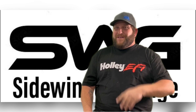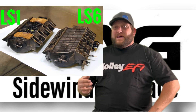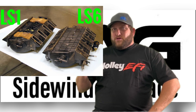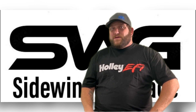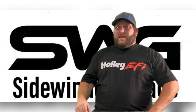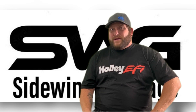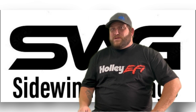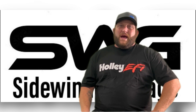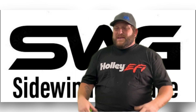Okay, a lot of information — now on to the intakes. We'll start with the LS1 and LS6. The runner design of the LS6 intake manifold is different compared to the LS1 intake. The LS6 intake has straighter and larger intake runners which allows for improved airflow, increasing horsepower at higher RPMs. This design makes the LS6 intake a great upgrade from the LS1. The LS6 intake manifold has a slightly smaller plenum volume compared to the LS1 intake. LS6 intake manifolds do not have provisions for the EGR system, while some LS1s do — that big hole on the side. That's an easy way to tell them apart.